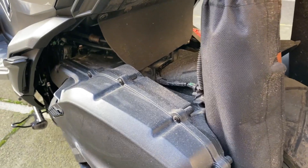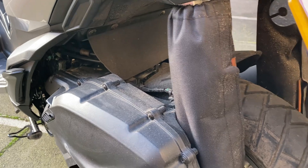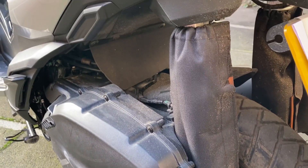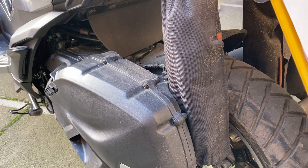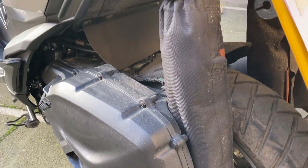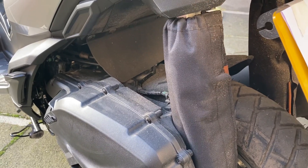This is Scotland after all — winter is coming, a lot of rain, we'll have snow and all kinds of things at some point. The bike does get dirty, so I got shock absorber covers, which are just going to keep the shocks in decent condition through the winter. The main concern is road salt when the roads get icy. I don't tend to ride when roads are icy, but long after the ice is gone the salt remains, throws up underneath, and can rot your metalwork. So shock absorber covers just to keep the shocks looking nice and shiny until summer comes again.